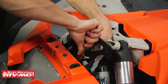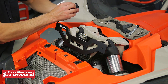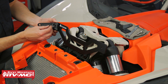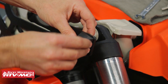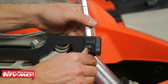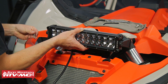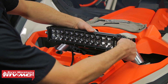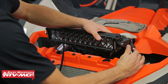Your light bar comes with several different brackets but the L-brackets are what you're going to use. Lay the rubber pad on the back side, then take the M6 by 25-millimeter bolt with the M6 lock washer and nut on the back side, thread that on, and do the same on the other side. Square these up and tighten the hardware down. To install the light bar, use the two M8 by 16-millimeter bolts going into the side of the L-brackets. Once installed, adjust everything for optimal fitment and tighten everything down.